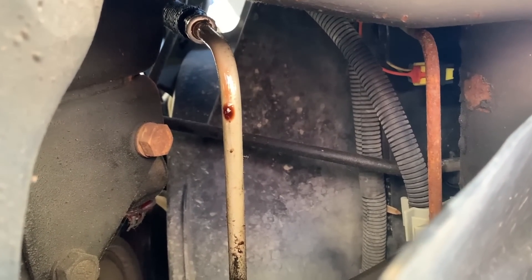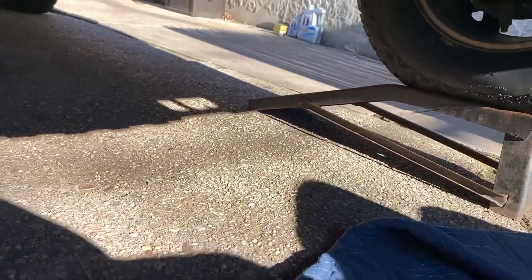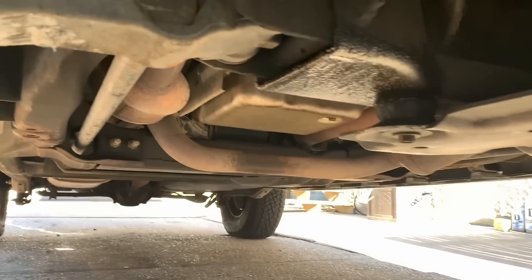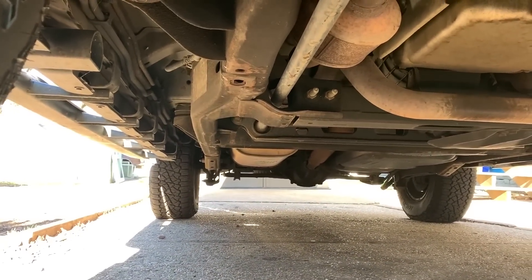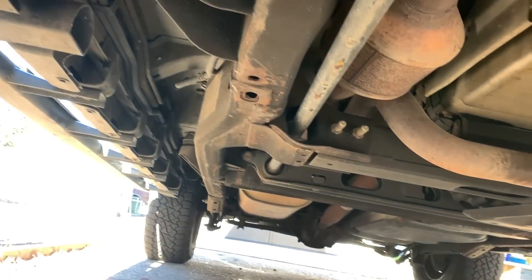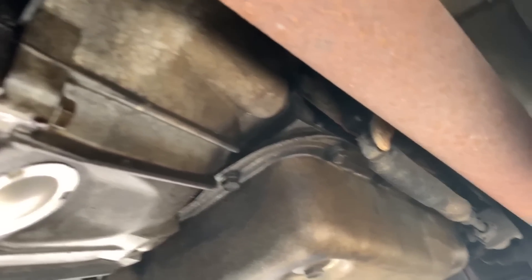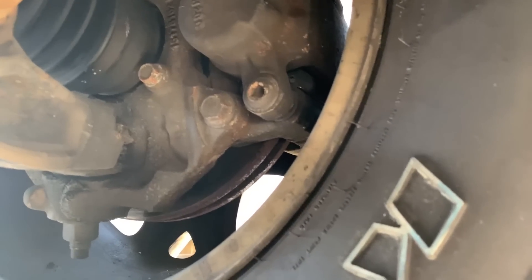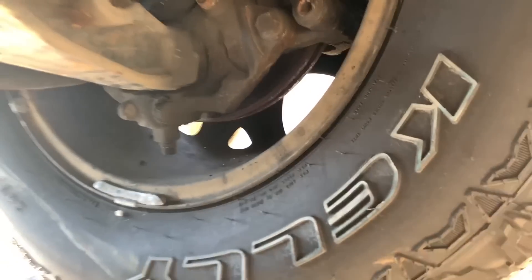The transmission hoses are leaking over here — you can see it's kind of coming down from the crimp connection there, it's leaving a spot when it was running. It's not pouring out, but I did go and order a new set of those. Steering box looks good, nice and dry, nothing leaking there. The brake lines I did notice look a little iffy — I'm probably going to have to replace them. I'm going to try to wait until summer to do it, but on these older Chevy trucks brake lines are always an issue. Look how clean this thing is though — there is no rust under here, all along the rockers. Doesn't look like the trans was replaced — it's most likely the original. At least under the front end looks really good. Nothing looks out of place; the rotors actually look kind of new. I wonder if they put new brakes on — it does have new tires, so there's a good chance.